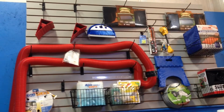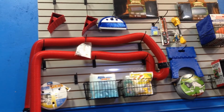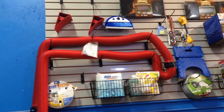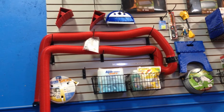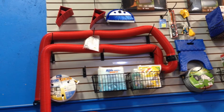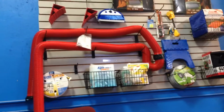And everything else is, you got black and yellow, that switches from your 30 to your 110 service. You can plug into the house and keep the batteries going. You just can't run your microwave or your AC off of it. That's the only downside. It doesn't have enough amperage, so that'll just charge the batteries. Just keep it all nice and maintained. Say someone's going to come hang out with you for a couple of nights, have them sleep in that.